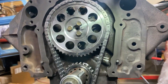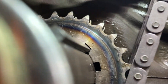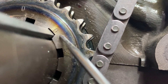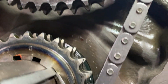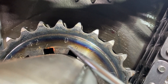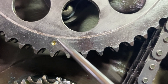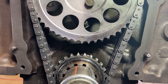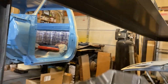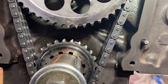My double row timing set is installed and torqued down. There are a couple of important things to point out for people trying to do this themselves. First, if you look at that crank keyway, see how there's a zero on that? That's not the zero you want to line up with your dot. You want to line it up with this zero - there are two different zeros: one for the crank keyway, and a different set of numbers around the top edge for the gear teeth. This is the zero you want to line up with your dot on the cam gear, and this is when your number one cylinder is at top dead center. I measured this with a dial gauge to make sure this piston is exactly at top dead center, right down to the thousandth of an inch.